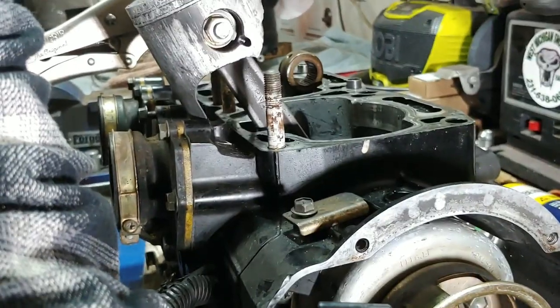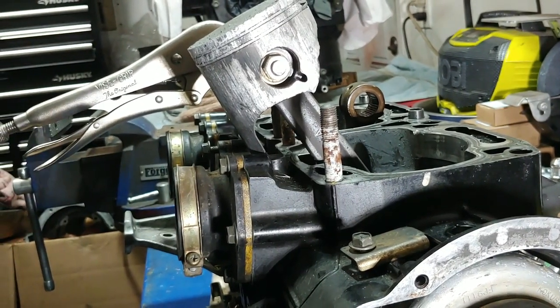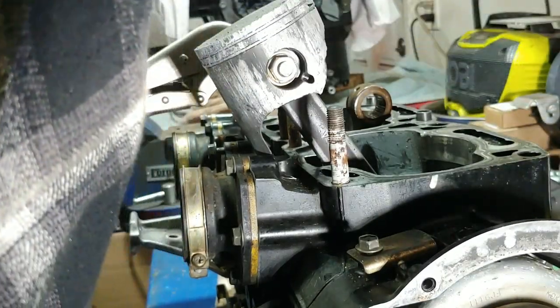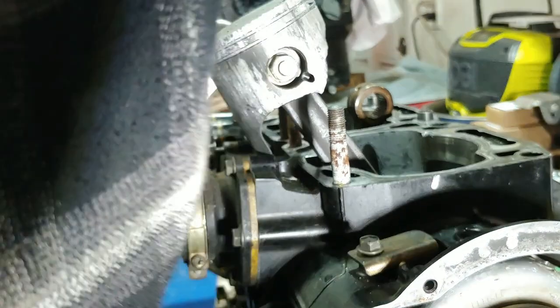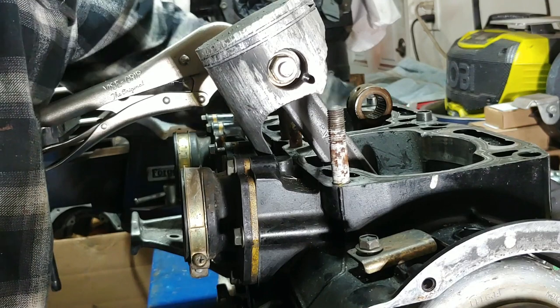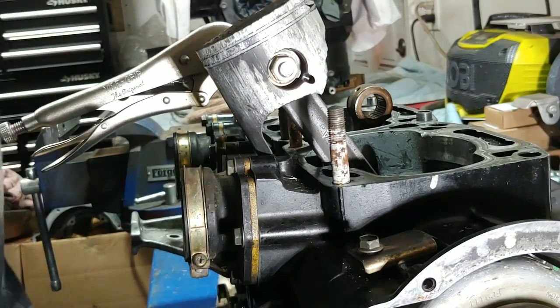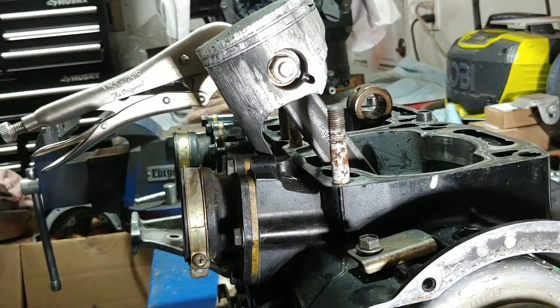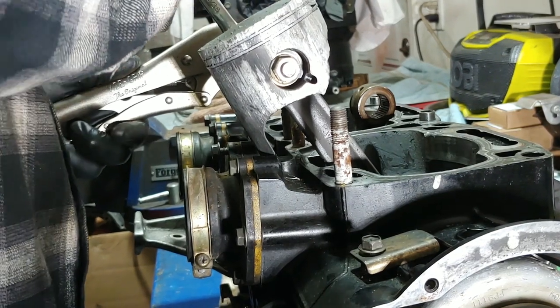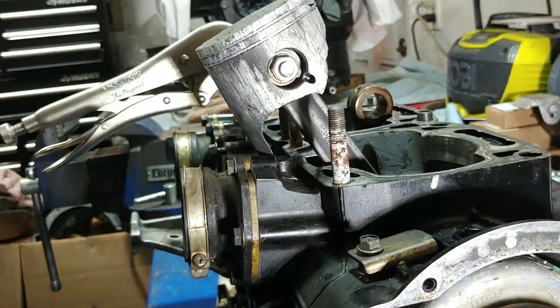I mean I had to make some adjustments to my method here, and I just figured I'd show you guys how it works - it's pretty simple. I was looking for a different nut because the serrated flange nut I had just wasn't giving the room I needed. The other thing I had to do to get this to even move was to heat the piston up with some MAP gas. I'm probably gonna heat it up again because it's been sitting for a minute.